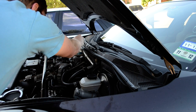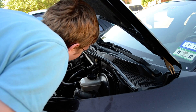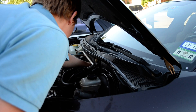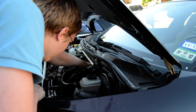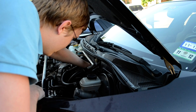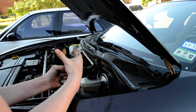I can see it starting to move — this is where you get to use a little human ingenuity. In this case, I happen to have a few specialized tools because of my horror story to help me get this off. Hopefully you don't have a horror story. Something you'll want to keep in mind: if there is oil in this oil filter, it does spill. When you're doing this from the bottom, it's usually a lot easier to get your hands on it, and easier to keep your drain pan underneath it. That's what a used one looks like — they usually don't take this much work to get on and off.